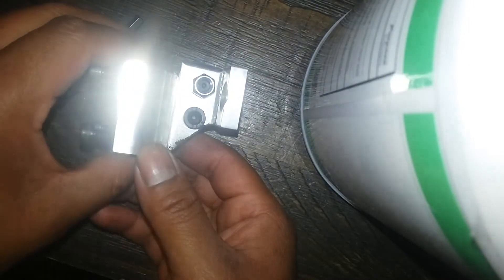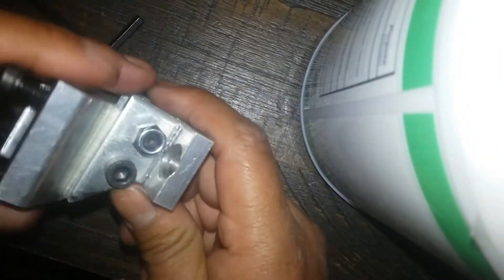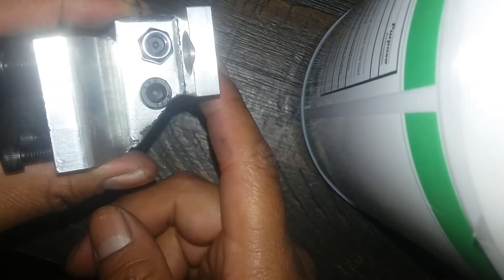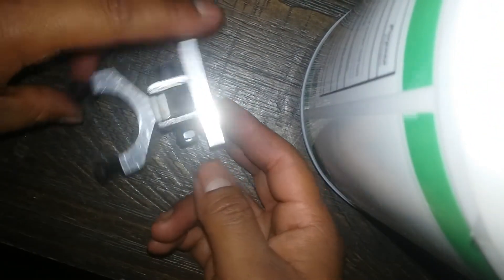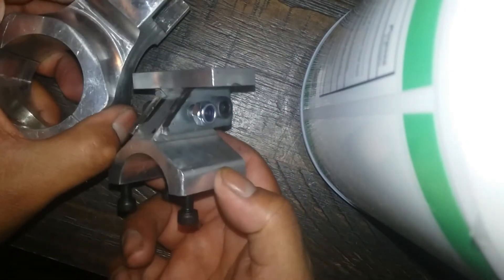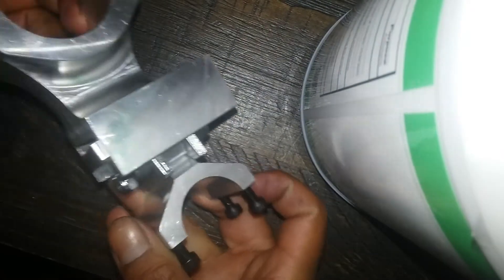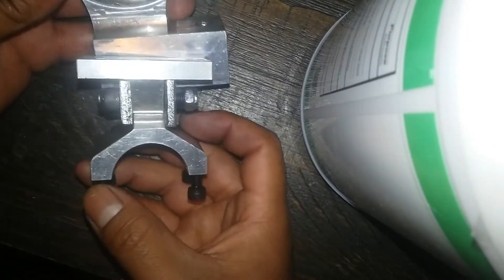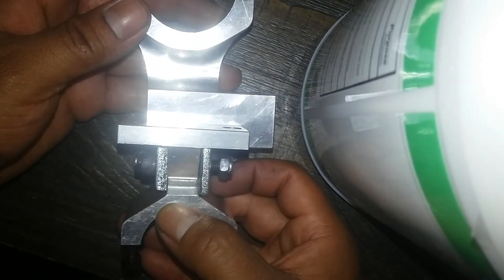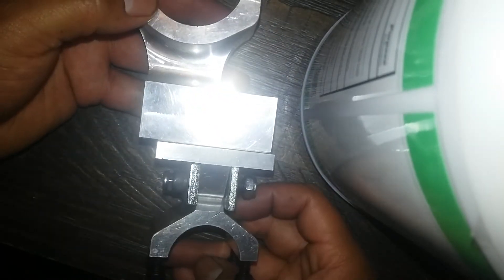There are sharpie lines here from when I was marking it, but it sits flush inside real tight. You can see it — it's a centered rear mount. I came up with this, it's pretty basic and real simple. I reused some hardware I had, because when I bought the FatFaker I got these motor mounts thrown in the deal. Now think about it — being centered, if you try to use this front motor mount, look where the holes are — it's going to be completely off.